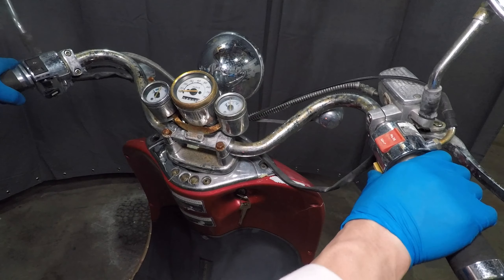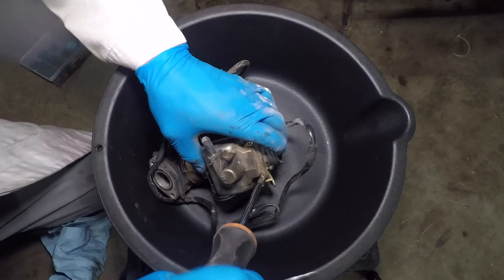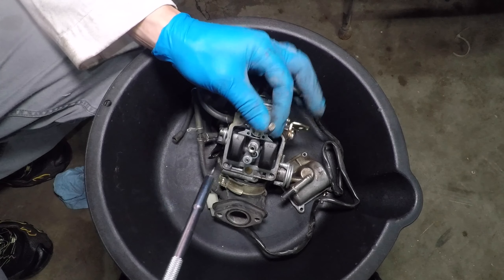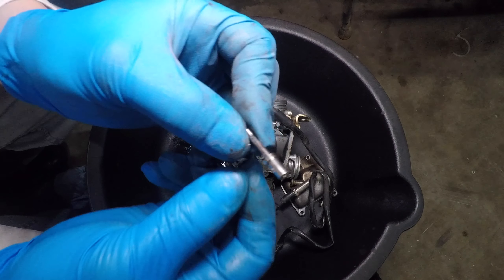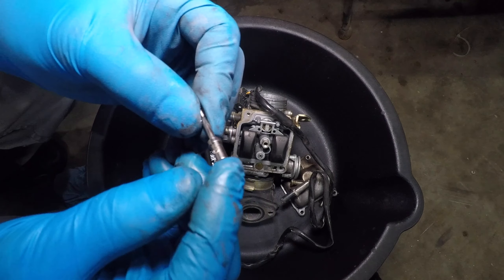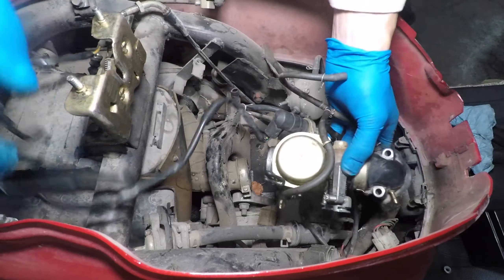Place the carburetor in a pan for cleaning. This hose is the fuel inlet, this is the vacuum line that operates the fuel pump, and this is the fuel drain hose. It's missing the screw so I'll pull it off and just plug the hole in the bottom of the float bowl. I want to open up the float bowl but these screws are stuck. The vice grips didn't work either, but my impact driver got it. Let's take those four screws out. Open up the float bowl and this carburetor is super clean — I got very lucky, the previous owner drained the gas. The little one is the main jet; these are usually plugged from sitting in old gas, but mine is clean. The long one is called the pilot jet — this controls your fuel just above idle. Also very clean. I usually replace jets but I can just put these back in. I'll spray the carburetor with carb cleaner inside and out just to make sure there's no dirt hanging out. Now I can just reinstall the float bowl — this thing might just work. I'm never this lucky.